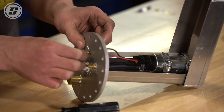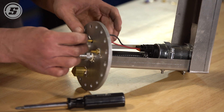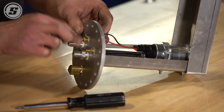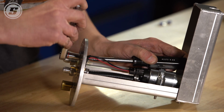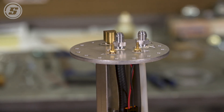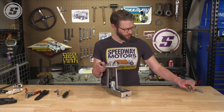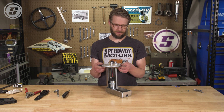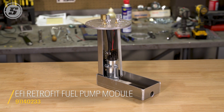Externally, the two O-rings that go through the middle go on, followed by the outside collared nylon washer, followed by the flat washer, lock washer, and nut. Our pump module is assembled. We'll install the gasket and then move on to installing it in the tank. The screws that came with it were a little bit long because they're meant to go through that retainer ring on a regular non-EFI tank. Since we have an EFI tank, we grabbed some shorter 10-32 screws, so we're ready to go.